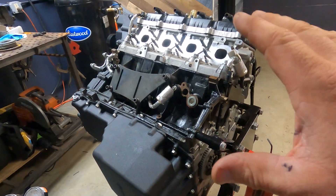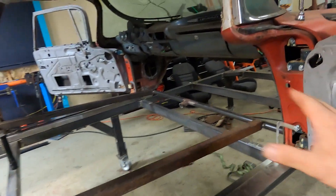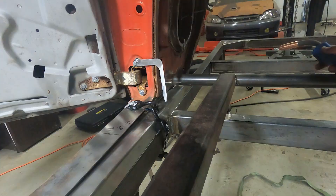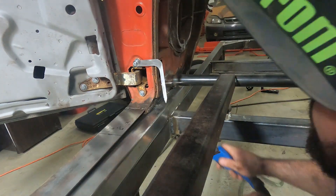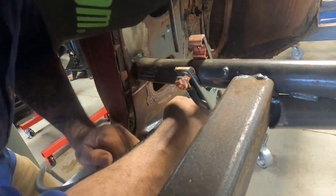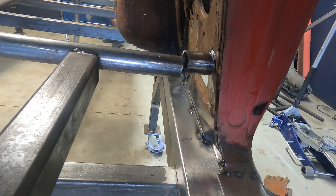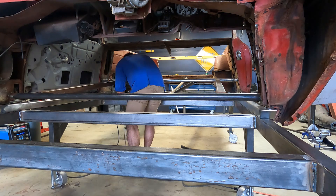This motor is going to be set in a very different direction — that's where the fun begins. After I get these forward and aft tacked, I'm going to rip out all this gangly tube because now it has structure. What you're seeing here are actual rockers I made. I didn't document this — I was just in the zone. The old rockers were so disheveled I just cut everything out. I used two-by-three square tubing, leveled it all off, capped it, and put it perfectly in the center of the rocker.